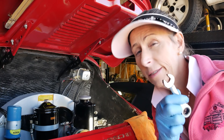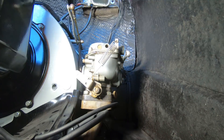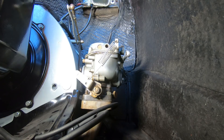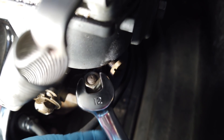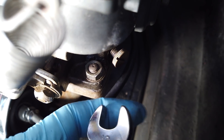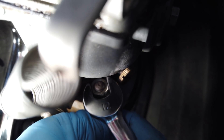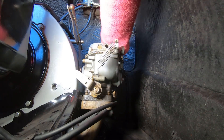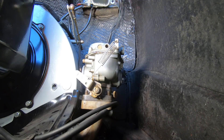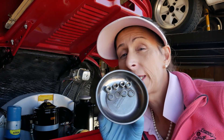These little short wrenches are awesome for that, and it's actually not too difficult to get all the bolts off. I like to use a little magnet to pull the washers off — it works really well. One thing to be careful of as you're loosening things up: can you see that little thumb screw? Be careful with the edge of your wrench that you don't slam into it and bend it, because these are made out of brass and are easily bent.